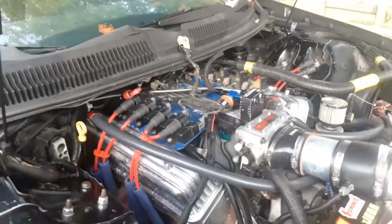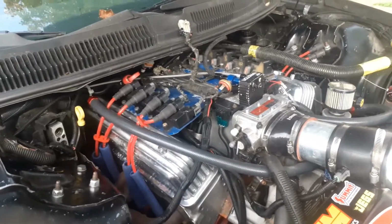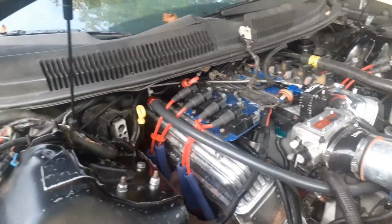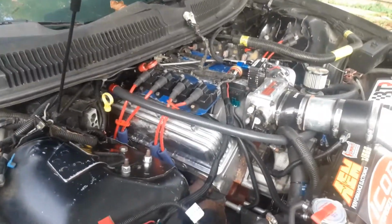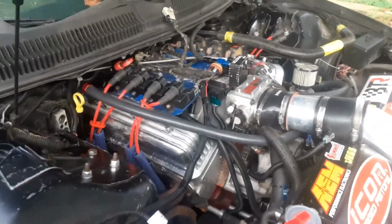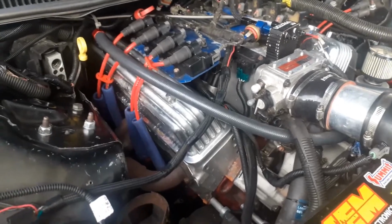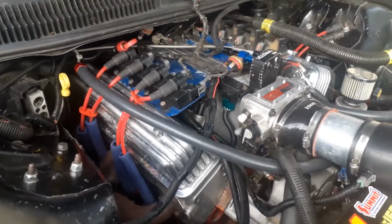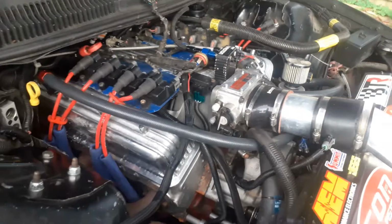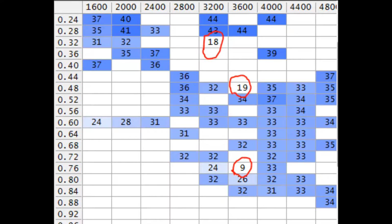Going to put it all back together, put 28 degrees through the board on a small block Chevy. Chris's car, it runs at 34 degree timing. It's locked out, so it idles at 34. It drives around at 34. So I'm gonna put this one at 28 and drive it around and see if I've got any fluctuation in the timing tables anywhere other than idle. There's a laptop. But yeah, got to finish putting everything back together.